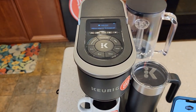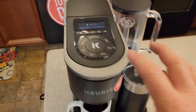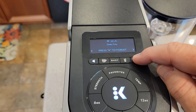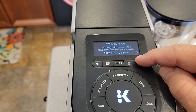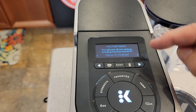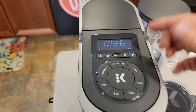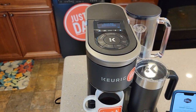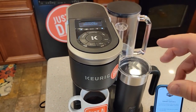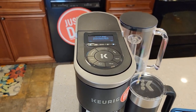After all of this, if you're still having problems, uninstall the app on your phone and reinstall it. You can also do a factory reset. Press and hold these buttons again to get into settings. Go past Wi-Fi, descale mode, descale alert, high altitude, language, water filter, support — there's factory reset. If I click K and click Yes, it factory resets this exactly like how you got it out of the box. You'll have to pick the language and reset the Wi-Fi setup. Sometimes that helps. You can follow my directions on setting up the Wi-Fi after you do the factory reset as well.